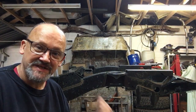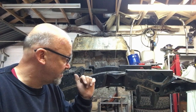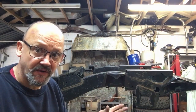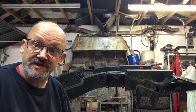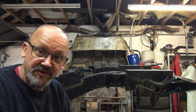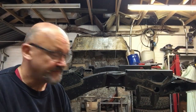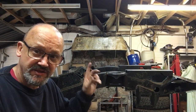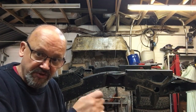Here you can see the chassis — done a lot of cleanup. When I got the Land Rover new I stripped it pretty much every nut and bolt, copper-slipped all the nuts and bolts which worked. I think I had one or two snap, one being a diff bolt stud in the axle. All the suspension bolts, all the little M6 bolts all around, all the little bolts along the floor and sills — they all undid. The chassis was wax-oiled from the day I owned it, all inside. I didn't spray the outside but the wax oil sort of creeps, so turpentine on a brush, brush it in, wipe it over with a rag, brush it in again, and basically we've got the chassis back to a painted state.